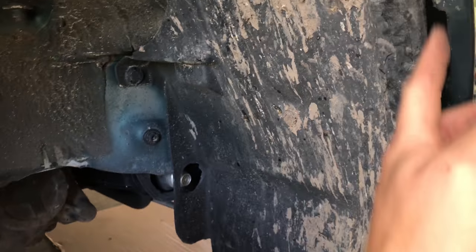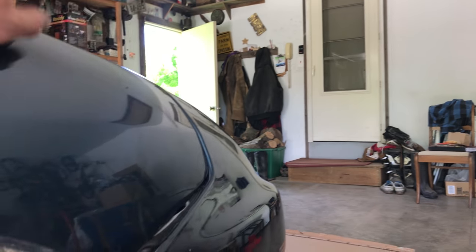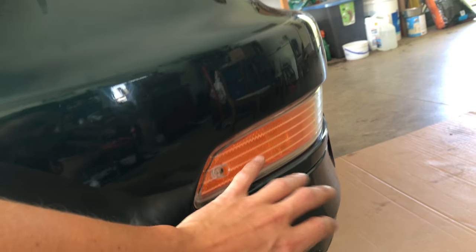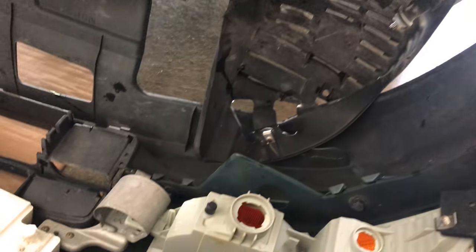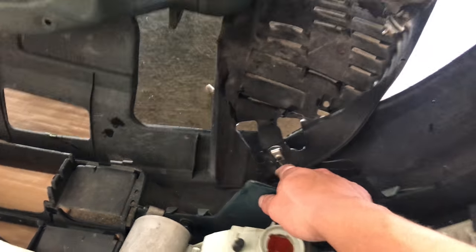There's just a little screw tab thing going up in here. Screw that out and you can see it pulls out, and then the rest is just kind of clipped in there, so you're gonna be able to push and pull the front bumper straight off. Make sure you go underneath though and twist out and pull out your running light bulbs — I forgot about these. If you still got your splash guards in your Integra, there's gonna be these little screw clips underneath. It's just a Phillips head — screw that out, there's gonna be one on the other side too. Then you got your bumper off.